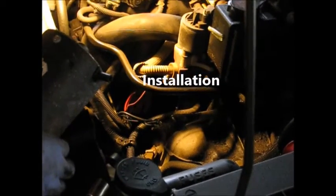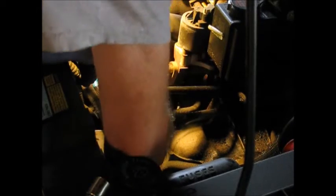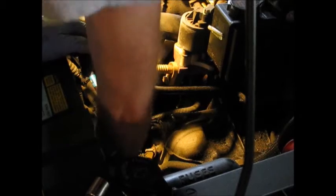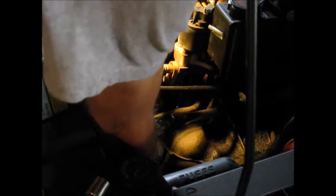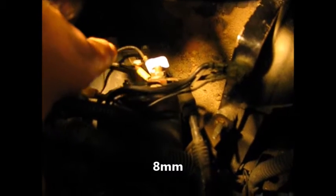So now we're just going to do the reverse with our new starter. Bring it down here. There are some air conditioning hoses underneath here — be careful around those. Get the starter back in position and wire it up. Here's a look at the wiring — make sure you wire it back up like this. There's the solenoid control wire and of course the 3 wires coming into the B-plus.